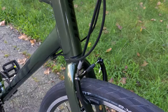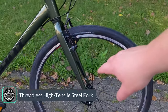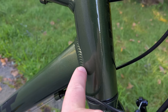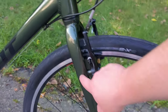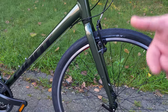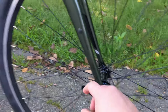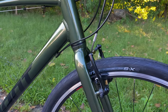Attached to the front of the bike is a steel fork made out of high-tensile steel. You can tell it's steel by the weld style — stacked small dimes versus the big globs on the aluminum. Steel is used here because it makes the front end a bit more forgiving and also reduces cost. It still runs fender mounts as well. Both the front and rear wheels have quick releases to make taking wheels on and off easy, and there are post-mounts for the rim brakes.